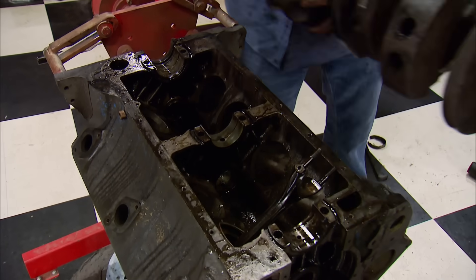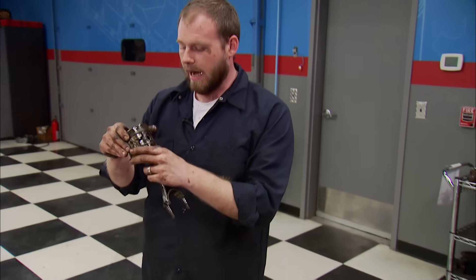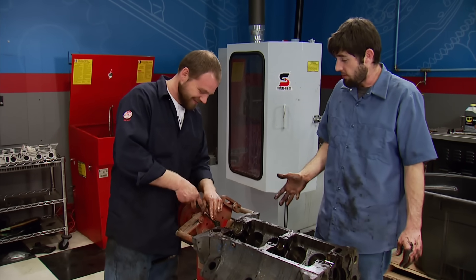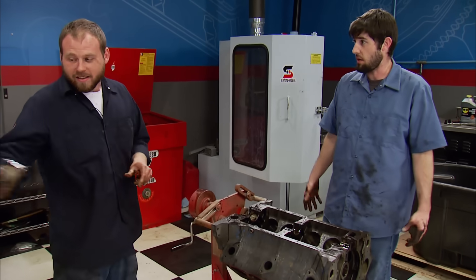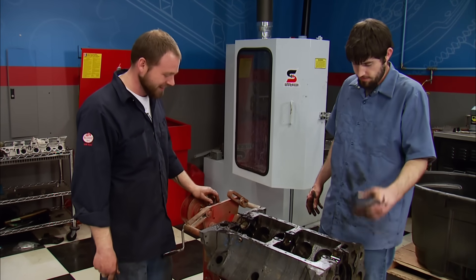There it goes. I'd like to say the last part to go is the crank, but we got one more piston we couldn't get to — got it. We got everything off of it we needed to get off and salvaged what we needed to. The block and the mains are really all we're going to be reusing. We still have to go to the machine shop and magnaflux it, so we'll see.